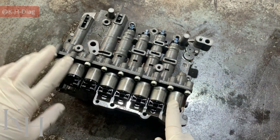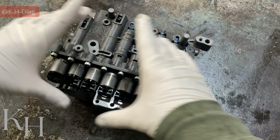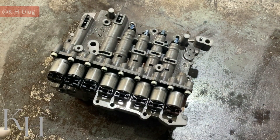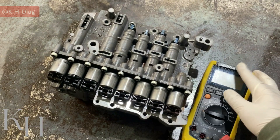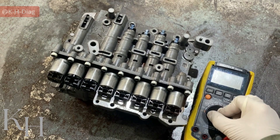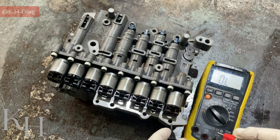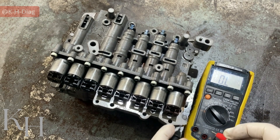So now we know the name of each solenoid valve. As I said earlier, I'm going to put some resources in the description so you can download them — it comes with a picture of the valve body and gives you all these details. For these valves, we have a procedure to test them. Testing procedure is actually testing the internal resistance using a multimeter. Majority of them are going to give you the same resistance, but we'll see the difference on some of them.